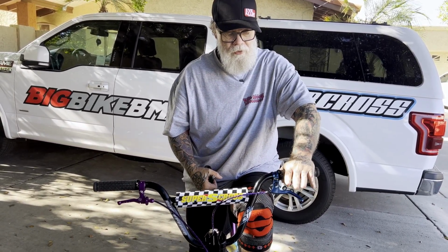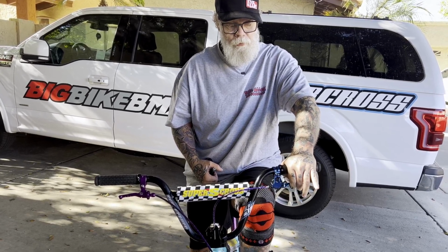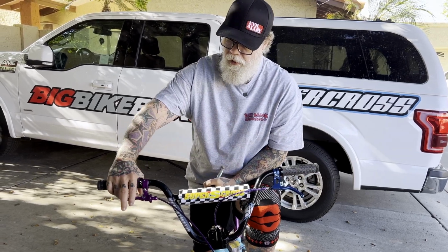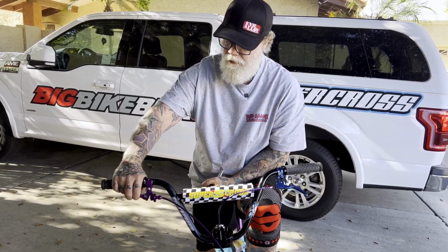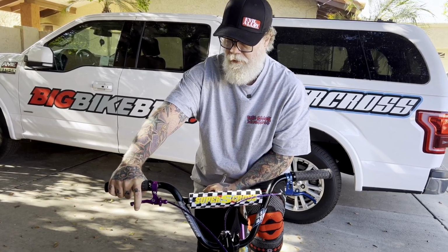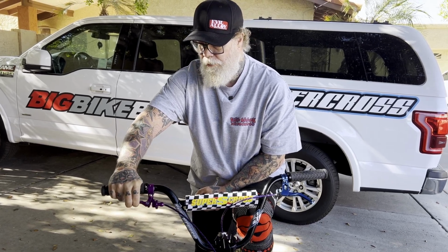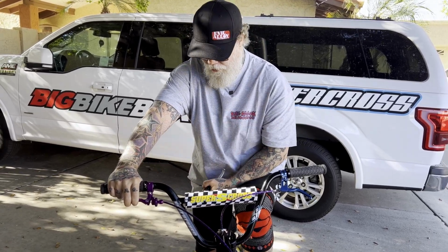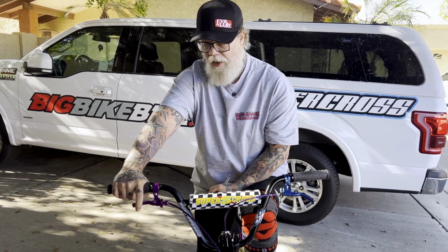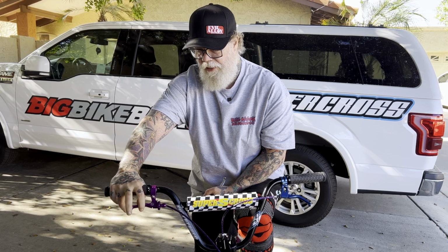2 is very comfortable. This is the Supercross Speedline Elite brake lever. So this one you have 1 finger, 2-finger, or 3-finger will fit. The Pro 1 is a shorter throw on the lever itself, so you really only have 2. If you see me riding in any videos with one of these doing a wheelie, it's 1 finger, because 2 fingers just basically will wear out my forearm too quick. So unless you have really dialed brakes and you're doing wheelies, I would say just be very careful and conscious of the length of this.